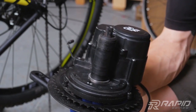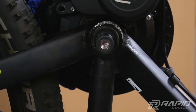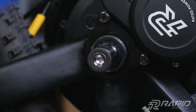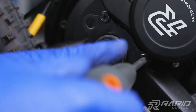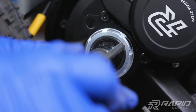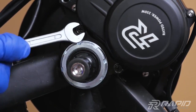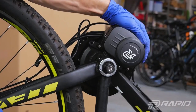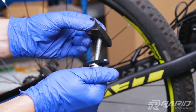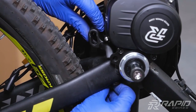If the tooth wheel is too close to the frame, add one of two spacers. And mount the motor in the frame. Put the black plate on the left side and tighten it using two screws. Put on the ring and tighten it. Then slightly screw the silver cap. Now you can use more force and tighten the screws. Tilt the motor to the back wheel and slightly screw in the lock to its body. Then use one of the screws from the package and screw in the whole motor to the seat tube.